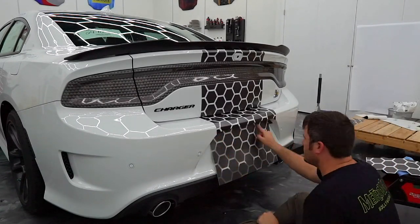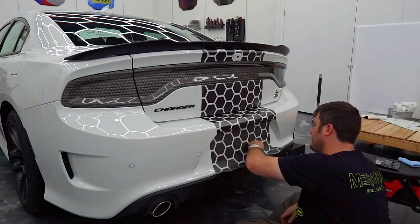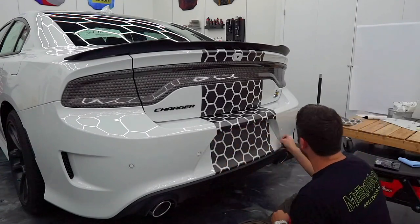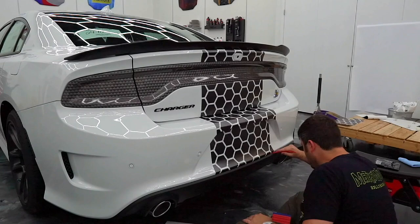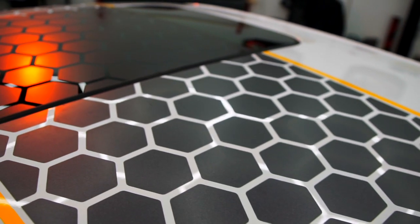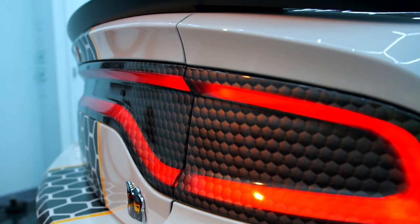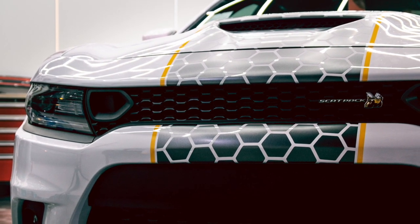From here we're just trimming. I'm not going to trim right on that gap yet — I'm going to cut a little bit away from it because I want to get that vinyl tucked nice and tight in there. By taking that little bit more excess away I've gotten rid of a little more tension, and naturally it's just holding itself in place now. I can ride my knife along the top of this textured plastic. We're done with the main part of the stripe — now all we have to do is come back with the pinstripes and this sucker's done. We'll see you next time.